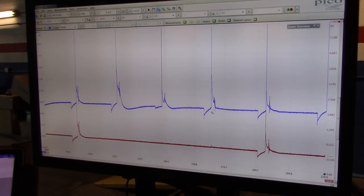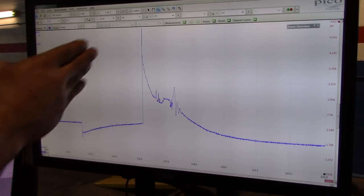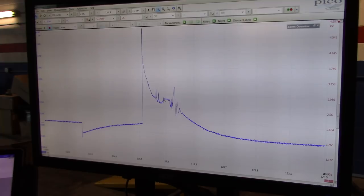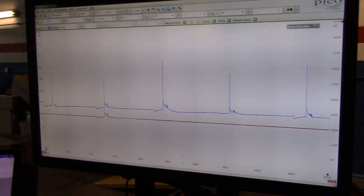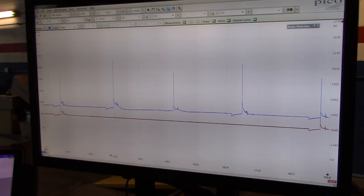Based on all the training and experience I have — let me zoom into cylinder number three. This is the spark and burn timeline. Whatever shows from the middle to the left is external to the cylinder, and from the middle to the right is internal. This looks like a shorted coil — or it could be the secondary circuit — it can be a shorted coil or a spark plug too, even though the spark plug is inside the cylinder, it might be jumping across the spark plug gap itself.